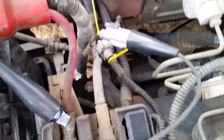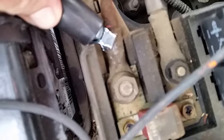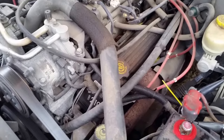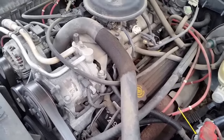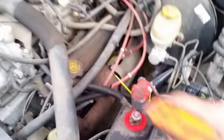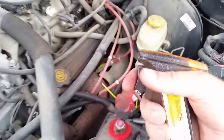I need to be able to operate the thing and actually drive it to the shop. So again: remote starter switch clamp on the starter signal wire, and remote starter switch clamp on the positive wire off the battery. This thing will not crank when I turn the key, but I've eliminated the obvious — starter works, neutral safety switch is good, all the relays are good. I've tested and swapped them out. With this start switch connected as such — positive wire and start signal wire — we can start the engine.